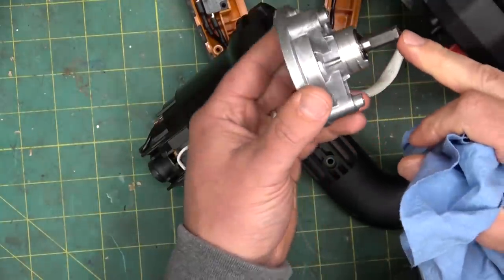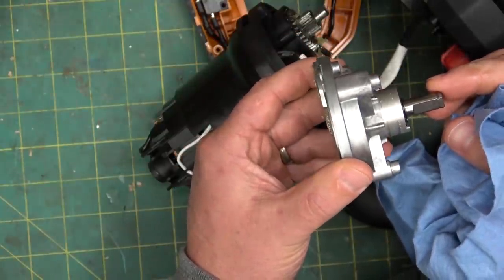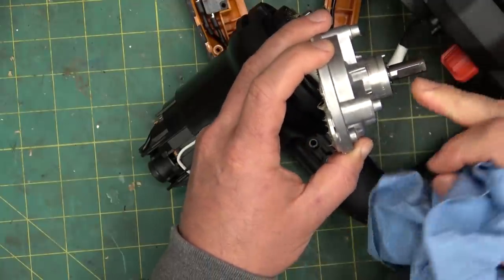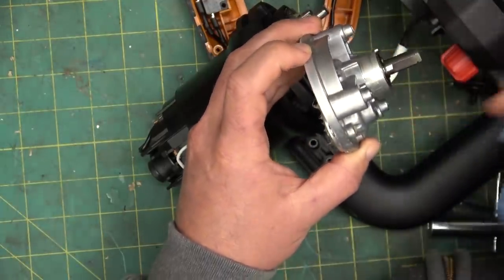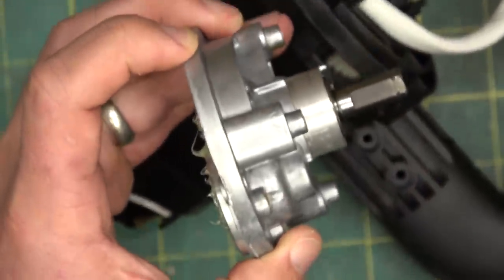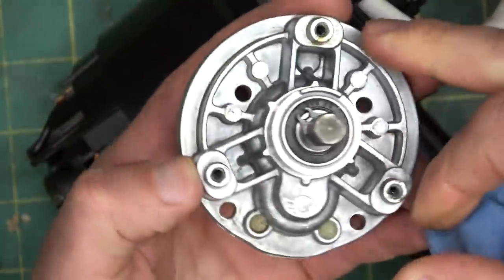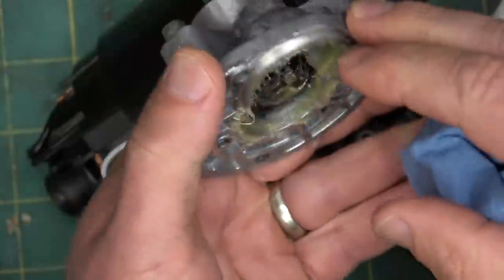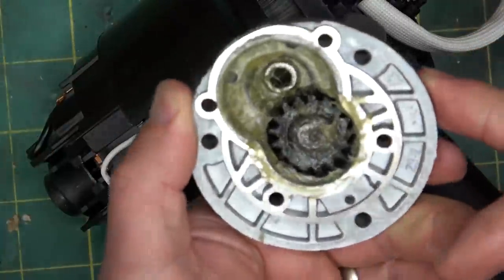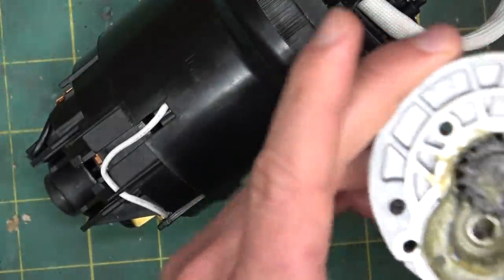We have an actual machine shaft turned, and then that's been milled, or, well, that's different, that might be live tooling on a lathe there. You look at the pattern on there, it looks like a turning pattern, but it's on a flat. Interesting. And we got one of those felt breathers, I guess. So when the thing heats up, it doesn't blow the seals right clean out of her.